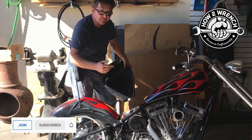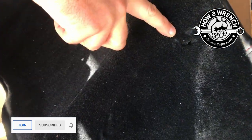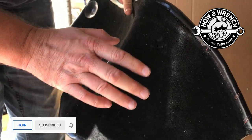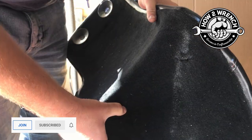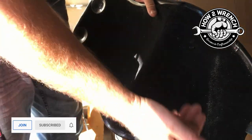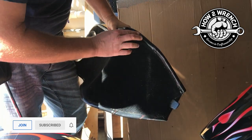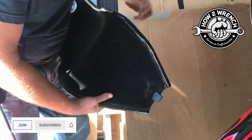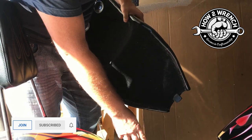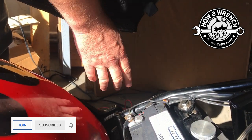Got the seat. I'm looking in these areas and I've got two pretty big pieces of evidence right away — come here. What do we see right there and there? We see indentations of the battery terminals rubbing on the underside of the seat. Part of it is it's going to hold it down, and there's no metal here that's going to cause grounding issues, but I'd rather not see it digging in. The other thing you can see clearly is this pretty stern support here. As that rests on there, that wire just sits naturally right there and you can see it would have been real easy to keep pinching it over time.